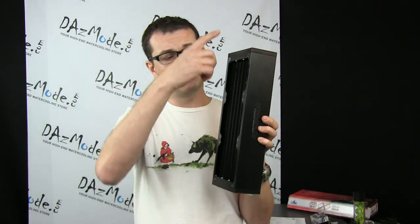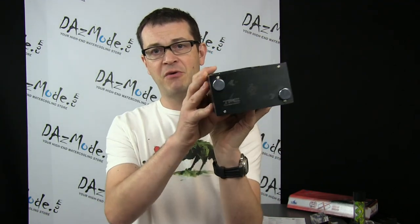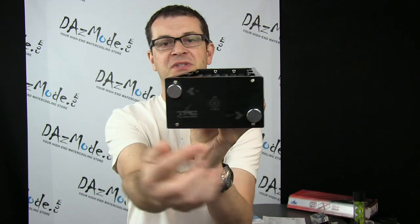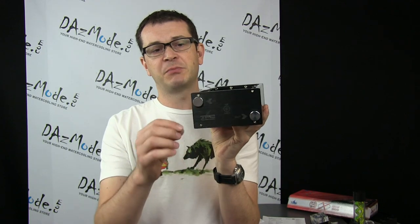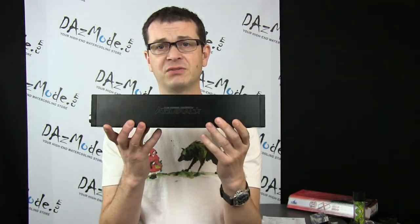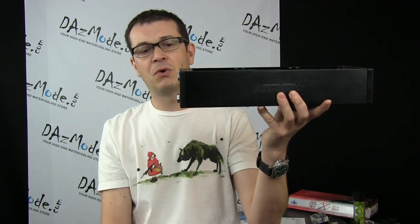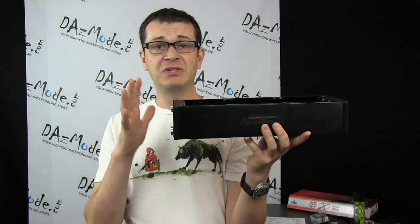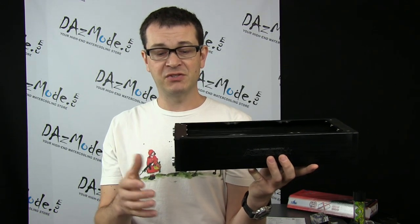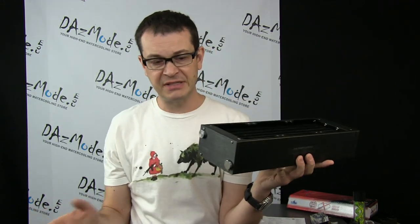Back to the sequential pass for the tubing — this also defines where the ports can be, because water coming into the first tube comes out of the last tube. There's no way to put ports in other places because it's an elaborate back plate that makes all tubes connect together one to another. So when you plan a build based on this radiator, you have to put fittings on the back of it, and most likely you'll have some sort of 90-degree elbow adapter and push your tubes down or up. This means you need a little bit more space in your case. When you look at the specs and see the radiator dimensions in millimeters, think that you'll probably need another inch or so for the tubing and fittings. Don't miscalculate that.